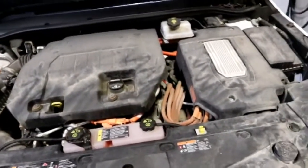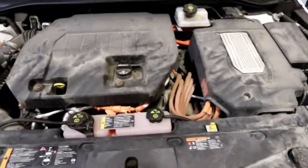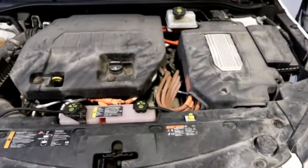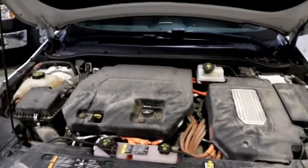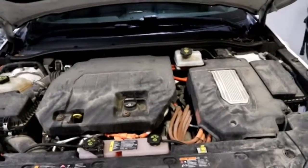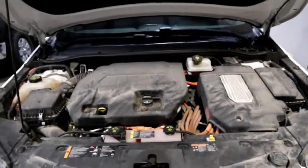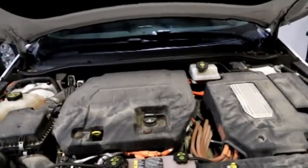Each system has its own cooling tank. In cold weather, it'll use coolant to help keep the batteries warm. You can do that by preconditioning the car when it's plugged in — use your remote start, and it will warm the batteries as well as the passenger compartment. It also has automatic seat heating, which will warm the seats for you when you get in. In EV efficiency mode, it will adjust seat heating automatically based on the heat of the seats, or you can do it in manual mode.